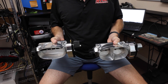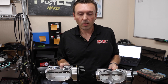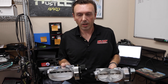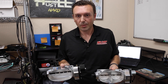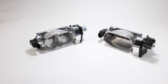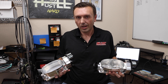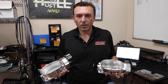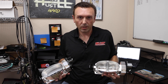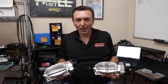Both use factory Ford TPS sensors, and they're both on the GT500 bolt pattern, so they fit all generations of VMP blowers and a bunch of Ford, Whipple, and other company blowers. They also fit some naturally aspirated intake manifolds — we have these listed on our website along with horsepower ranges showing where each throttle body is good up to from an airflow standpoint before it becomes a restriction. However, there are more nuances than that when selecting a throttle body.